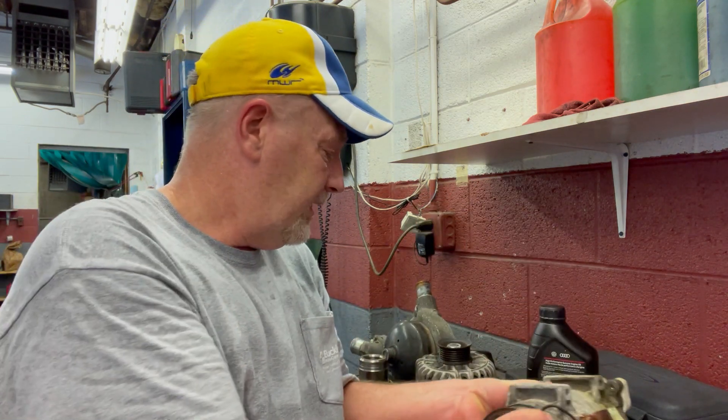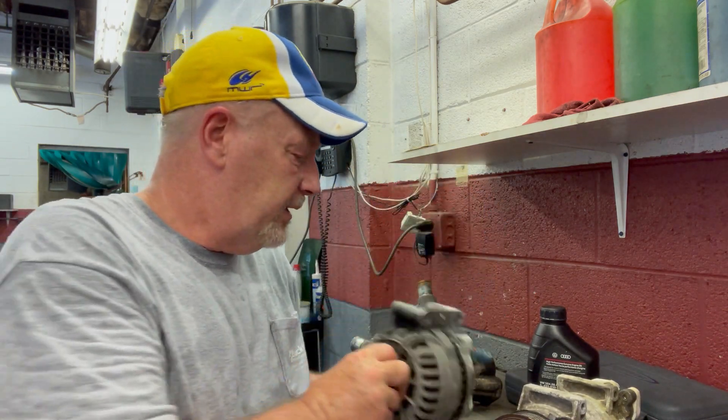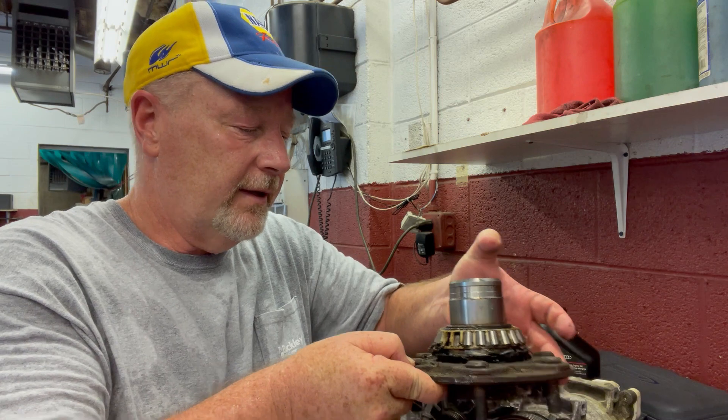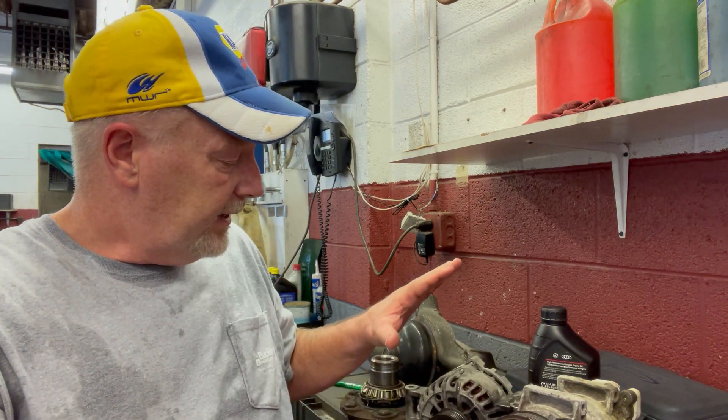This brings to your attention things that are affected by heat. I've got my cast of characters here today: the AC compressor right here, the alternator over here, a water pump, and right below me is a hub bearing. What are we going to talk about today? Fatigue. Each one of these components is what we call a rotational part — it spins and moves. During heat like most of us are experiencing right now, it is really traumatic on all components, but even more so on everything that rotates, since rotation creates heat that has to be dissipated.